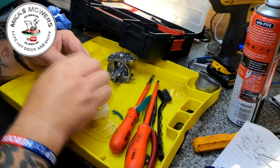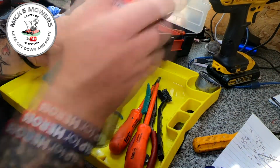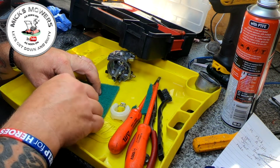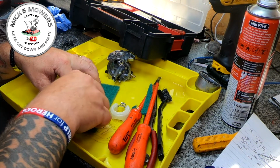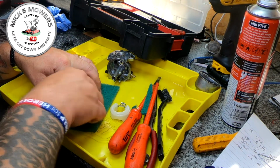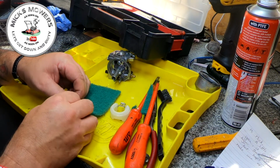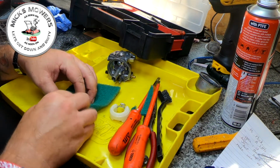And then with my float, my needle, all I'm going to do is spray a bit of stuff on here and literally give it a scrub. You can use some wet and dry paper. Just try and get some of this smeg off of here, just so it doesn't get stuck. A bit just there I want to get rid of. Yep, Toro's still running. Oh, that's a bit better. That's a bit cleaner than what it was beforehand.